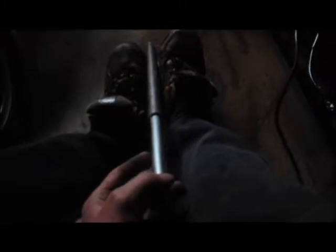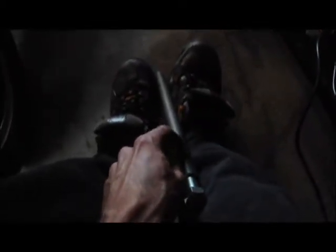What I have to do is take the drive shaft, chop it, put a length of this in there. I don't even need to weld the two ends. I just want it in there for weight and to stop it from twisting. Then you put it on there, there's a little bit of overlap, and I just weld the shit out of this side. If I feel like it, to make it really sturdy, drill some holes through the whole thing, slide in some rods, and cap weld them. That stops any twisting in the drive shaft. And with this being so snug, I should have a pretty balanced drive shaft. It worked out before. I've got like 20 seconds left on the video, so wish me luck.